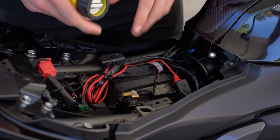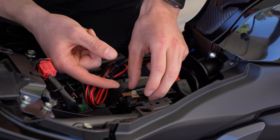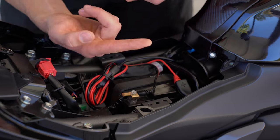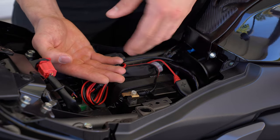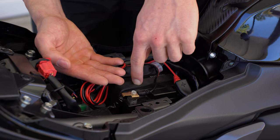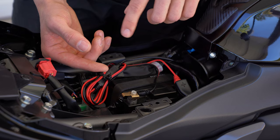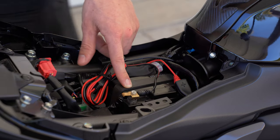For this part, don't undo the battery terminal screw fully, because under each part of the battery there's a little nut that falls to the bottom and you need to hold it up to screw it back in — which is an absolute pain. So just undo it a little bit but keep it connected to the screw so it doesn't fall all the way down, then hook up the new cord.